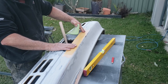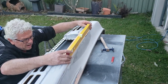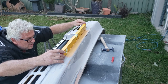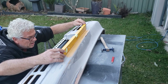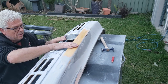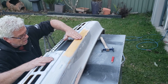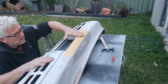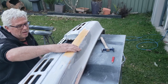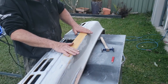It's starting to feel really, really good. This is how you get all the filler out of stuff — you've just got to work the underneath part, whether it's a plastic bumper or a steel panel. The more effort you put in, the less filler you're going to need. I'm rocking a straight edge — a little level — across it to watch the light underneath to make sure the curve is even. I'm not looking for it to be flat along that line, because it isn't a straight line — I'm just looking for a gradual curve without highs and lows. Pretty happy with that.